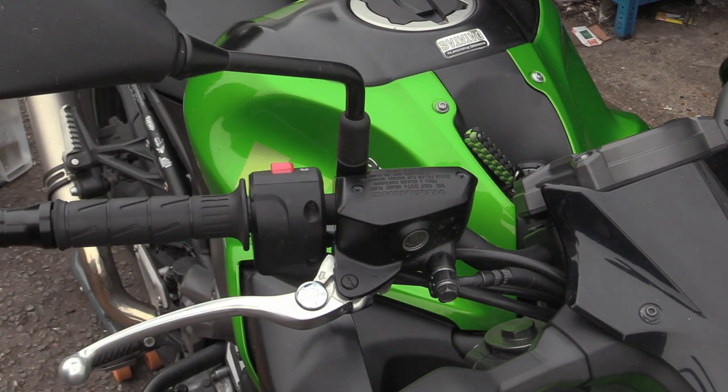Like I say, we'll follow up, see how this goes. I'll do probably another recording in like a week if she's still bad. I'll do a recording if she's gone, but we'll see what's what. As far as I can tell, the only probable cause I can see is that something broke off that pad and has been trapped in there, and it's a lump. It's a lump that's trapped in there. As soon as you get off the brakes, there's a gap. It's moved into that gap as it broke away. And when you clamp on now, it's just singing against it. I imagine the brakes aren't feeling different, not that I noticed. And I was wondering, are these brakes any different? Because I can hear that noise. We'll see how she goes.